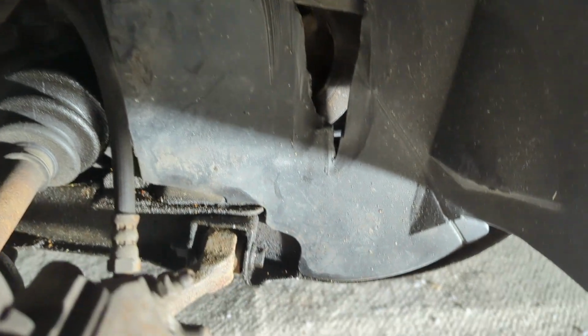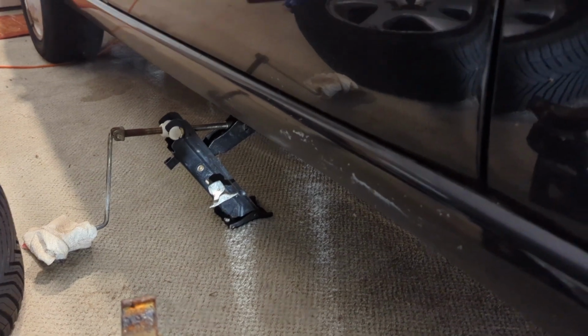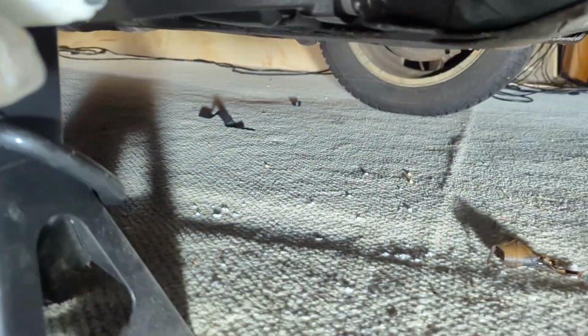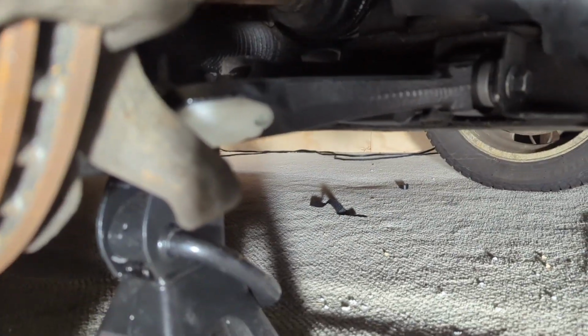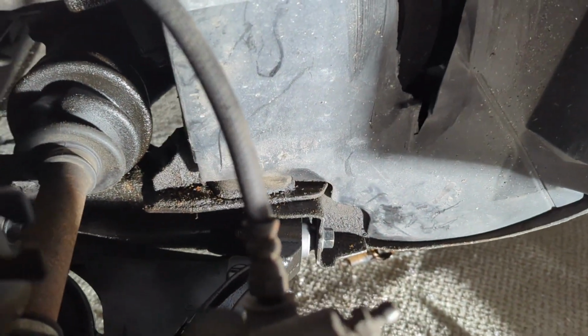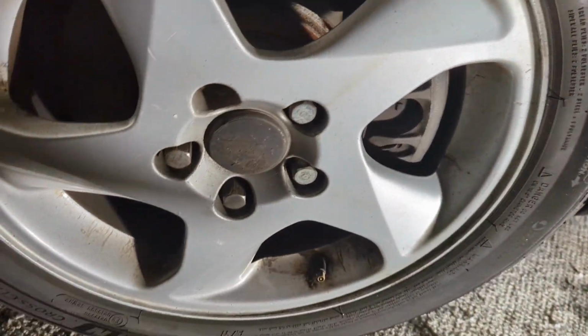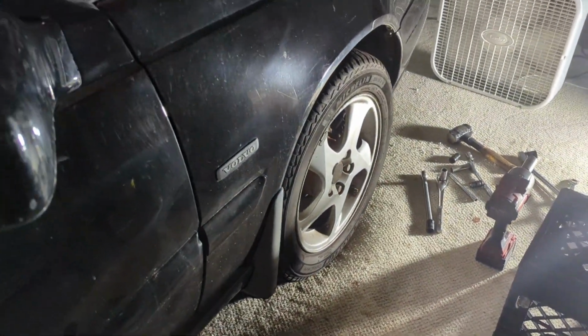That's how that's supposed to be. All right, let me get this control arm on. I loaded this control arm by putting the jack stand under here without the jack stand piece. Loaded it, lowered it until there was no more weight on the jack. Now I can tighten those 2 bolts there. One side down, one to go. We got a lug nut broke off in the hub. I moved the wheel stops over to this side. Let's go do the other side.